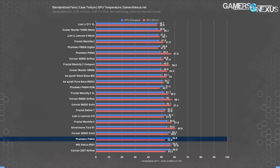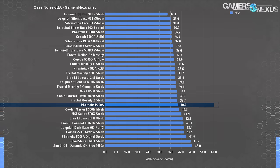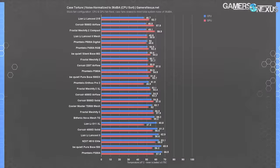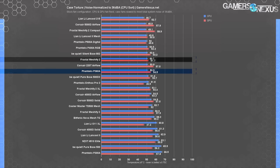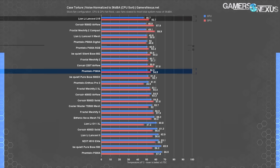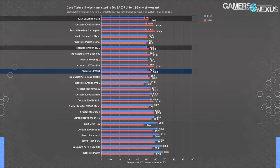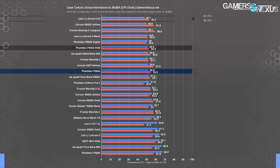For noise testing at 100% speed (approximately 1500 RPM), the two 120mm stock fans resulted in a combined noise level of 40 dBA. Lowering to 73% (1200–1250 RPM) achieved our target threshold of 36 dBA. At this fan speed, average CPU temperature was 51°C, tied with the Fractal Meshify 2 and P400A, while the Lancool 215 retained a significant advantage at 47°C thanks to its large 200mm intake fans. GPU temperature was slightly worsened to 54°C average. Running stock fans at 100% is past the point of diminishing returns.